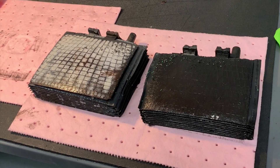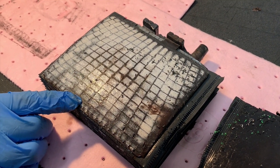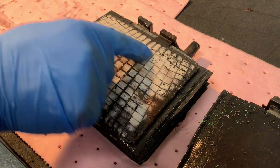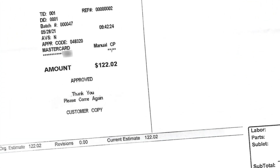What you're looking at is the difference between a happy customer and the other kind. That white stuff is sulfation, where electrolytes have hardened into the paste, making all this surface area unusable for storing a charge and making this battery more likely to die earlier than you or your customer would like — especially if they paid $120 for it.